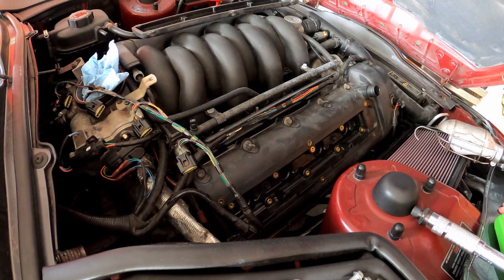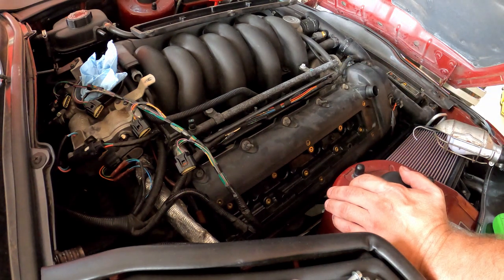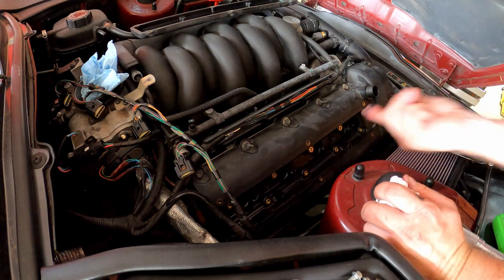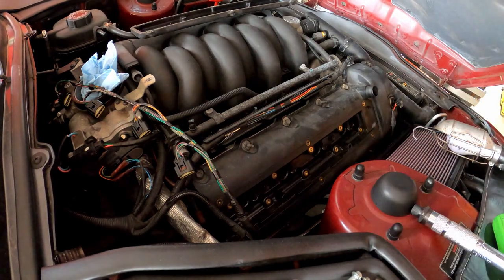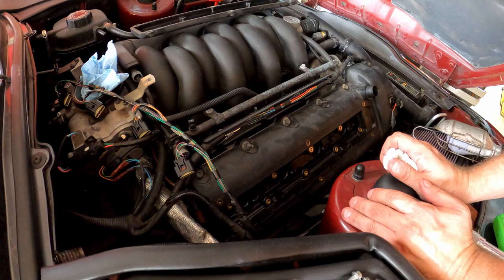I think we're ready to clean our connectors, put our coils back in, and let it set for a little bit to give that silicone just a little time to firm up. You don't really have any pressure on this — you can actually proceed fairly quickly. About 15 minutes is a must for this stuff to set up enough that you can drive off. Just checking our seals — as you can see, we have quite a bit of push-out. I'm just going to smooth that off so that our coil packs don't get bound up by it. Typically about the time it takes you to get all this cleaned up and put back in, you should be fine to drive off.